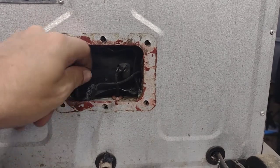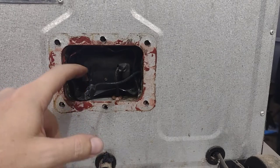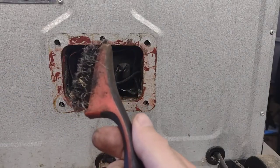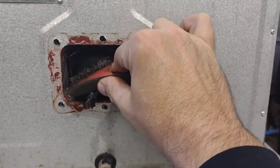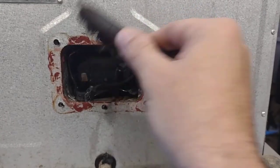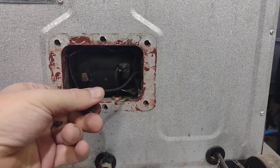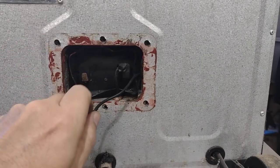I went ahead and broke off all the remaining bits of the terminal that was stuck. The terminal for the heating element that sticks out of here is not broken off, so that's a good thing. I'm going to take this wire brush and clean this up as much as possible, because I suspect it was a loose connection with some corrosion that built up a lot of heat and kind of melted this thing out. So I'm going to clean this up, pull this old connector off, and give it a shot.